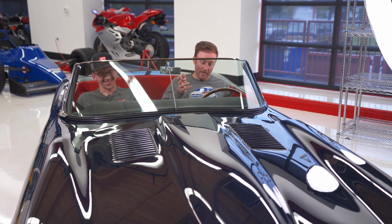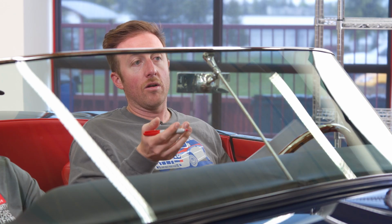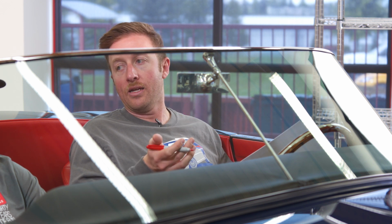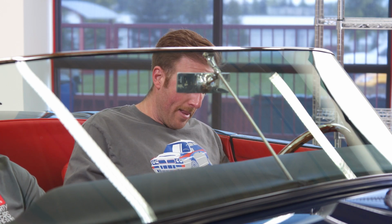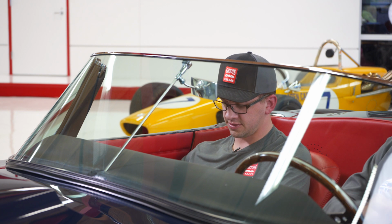Rich Smith, we addressed that question about windshield wiper chatter after applying glass sealant. Our most common solution to that is to change your wiper blades, primarily because if you've just done all this work to perfect your glass and then put the sealant on top of it, the blades have gotten used to how your glass was before that, so they're just responding the only way they can. In general, it's the degrading blade that's responsible, as it can't find the same pattern. So I'd say 9 times out of 10 that solves the problem for you. Or clean the wiper blades, as Speed and Shine TV suggested yesterday. We felt that was important enough to repeat, just in case there are others out there.